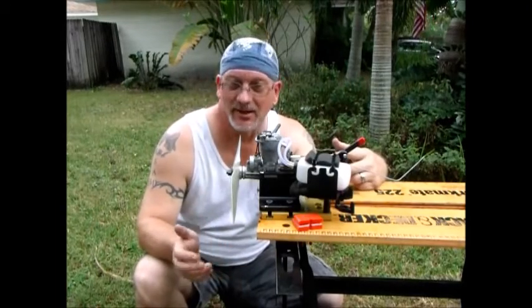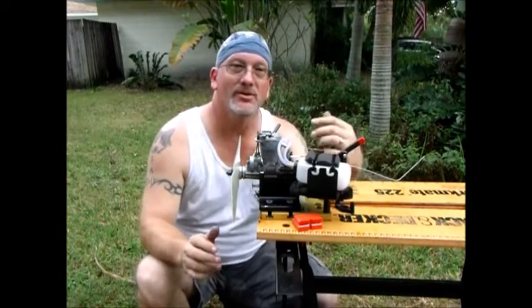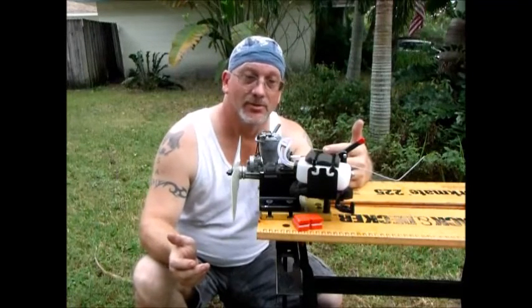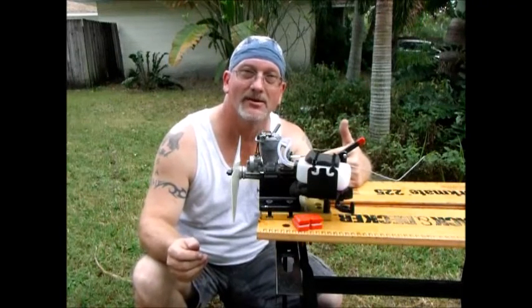The next tank, I'm going to run at a considerably lower RPM. I'm going to let it cool down because it's rather warm. But you could see the difference between a really rich setting and then a considerably leaner, or pretty much peaked, setting. Now, I would never set my four-stroke engines on the ground to be peaked like that.